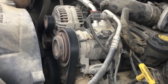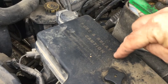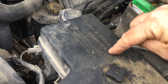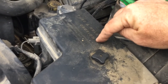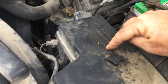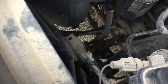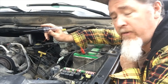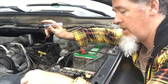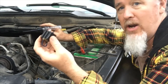I don't have a scan tool, but I'll assume the pressure transducer is working correctly since the clutch is turning off at about 450 psi. I checked the integrated power module and verified the fuse and relay for the condenser fan — both operational. I jumped relay cavities 30 and 87 and that did not turn the fan on. I can see the fan and it does spin, but disconnecting and reconnecting the connector multiple times did not make it kick on.